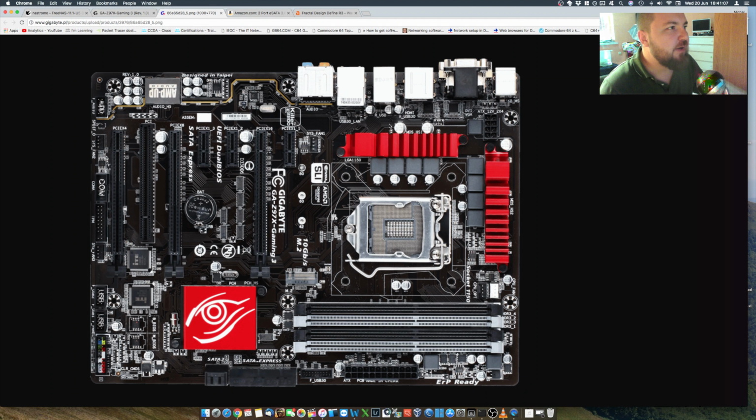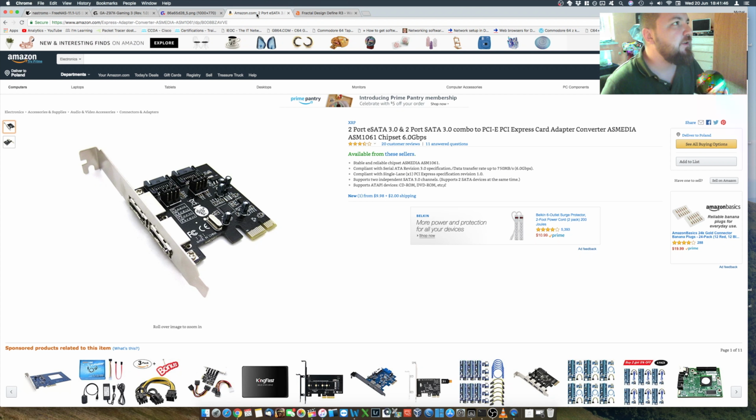You don't need to get a motherboard like that, so it's always fun. It's always nice to have Japanese capacitors, so you won't have any leaks, so decent caps are always good to have. It's nice to have that M.2 slot, the ability to install an M.2 drive basically for cache. I'm not installing this right now, although I am planning to, so there will be an update video to that. At the moment, I'm just using all 6 SATA ports that are available, so this will give me 6 drives, plus I'm going to use this one.